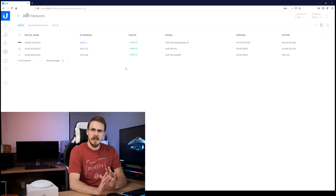I know there are a lot of numbers in this video — I apologize. What makes the Nano HD worth the premium as a standalone device is the wireless hardware inside it. Remember how the Nighthawk has only a single radio broadcasting two bands? The Nano HD has six separate radios: four just for 5 GHz and two that handle 2.4 GHz on their own. Those six separate radios operate only on a single band each, meaning the Nano HD is capable of handling six separate packet streams to six separate devices simultaneously, whereas the Nighthawk can only serve one device at a time before turning its attention to the next.